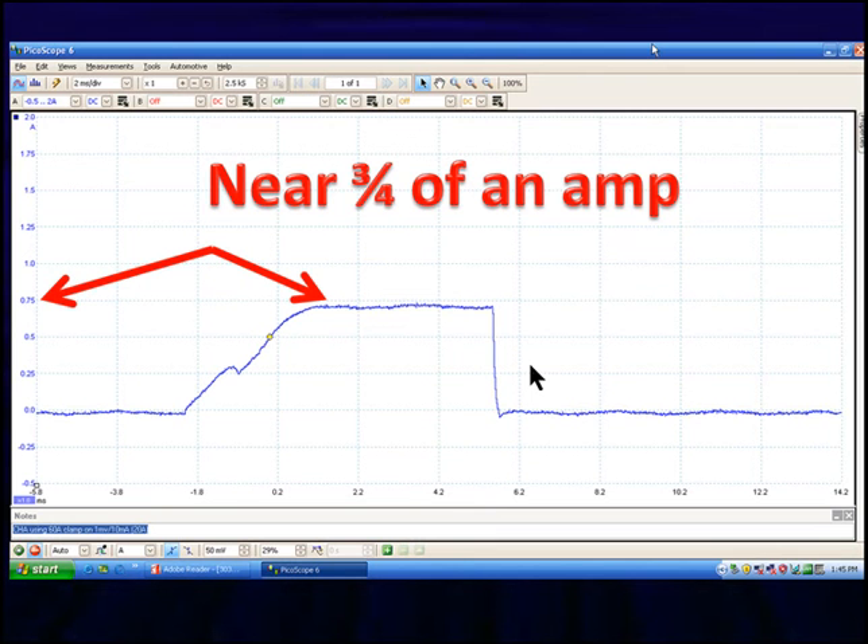When I get this reading, what does it mean? It means the PCM ground all the way back to battery negative is good. It means the PCM and its internal grounds are good. It means the PCM driver is good, the circuitry around the injector is good, and the injector coil has normal resistance with good B-plus applied. We wanted to test a number of things at one time — and that's what we just did.